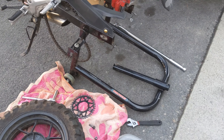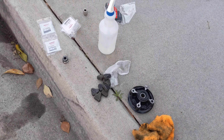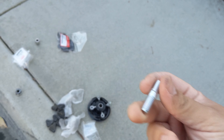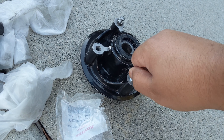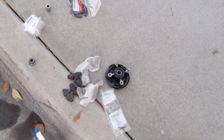So this is the stud itself — I got two studs to replace and four nuts. They are locking nuts — like little castle nuts — has a little nylon on the inside so it doesn't back out. But I'm gonna use loctite on it. I'm gonna use blue on those for the sprocket, red on the studs because I really don't want those to come out. And then this is the damper — it's an exhaust gasket, because I lost where I put the old one; that's why the other exhaust hasn't been put on.